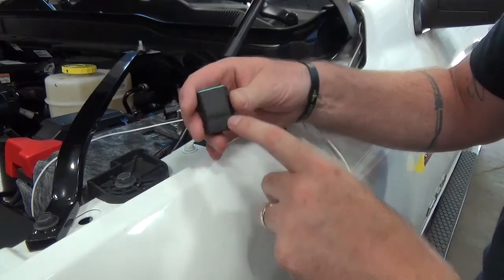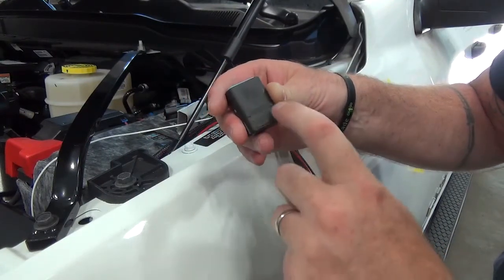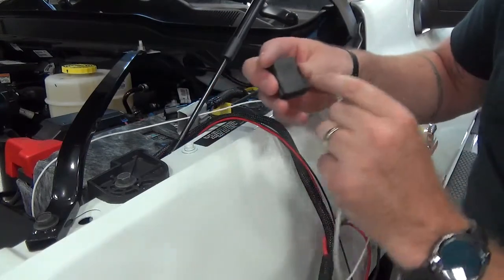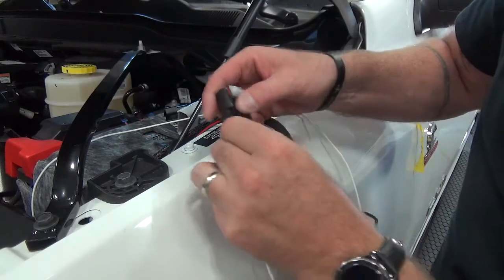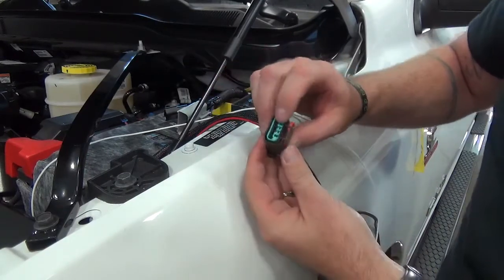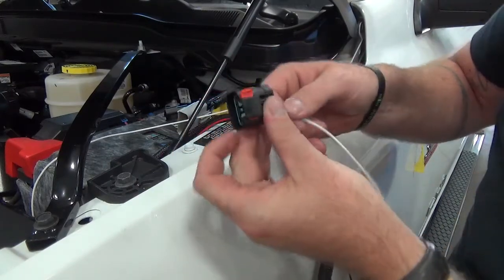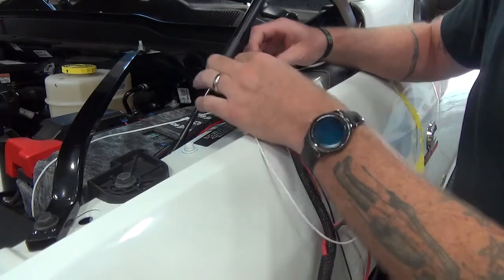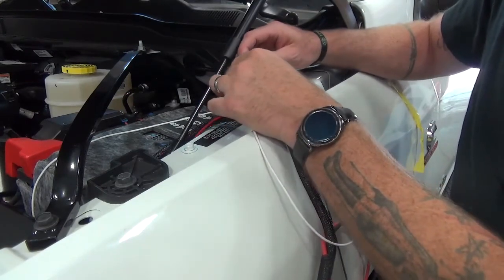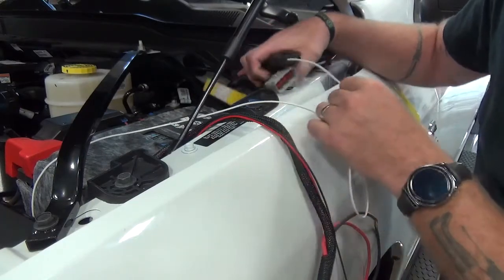If you look on the connector on the back side, there are a 1, 2, 3, 4 molded into the connector. You're looking for the number 1. That connection goes right into here. Push in, it snaps, the blue locking pushes down, and now you have terminated the connector. This then will plug into your ESS vehicle receiver. This connection should be done before any battery connection is placed.